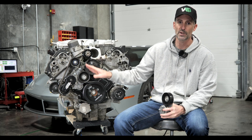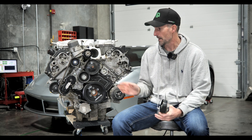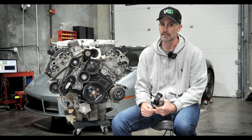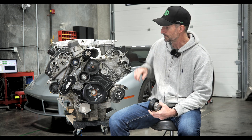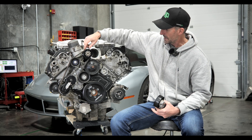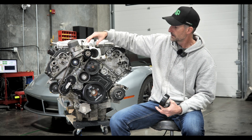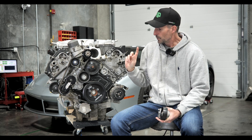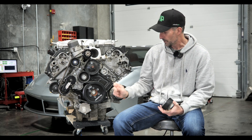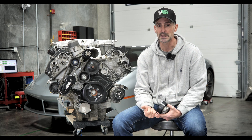The way this system works is not ideal for a supercharged application. If you compare it to other vehicles — like the Audi 3-liter engine — you'll see that the supercharger upper pulley has a substantially larger amount of belt wrap, almost 180 degrees. When you start driving these superchargers harder — by fitting a crank pulley, an upper pulley, and especially on the 5-liter with the 2300 kits we just released — you put significantly more load through this belt.